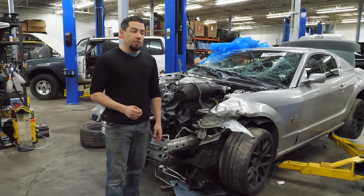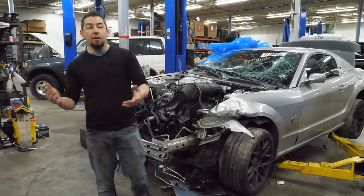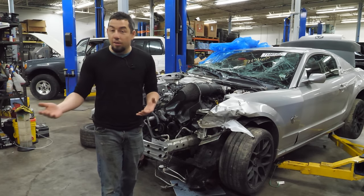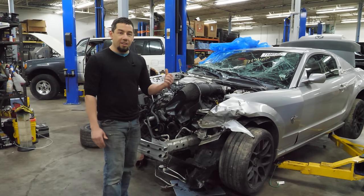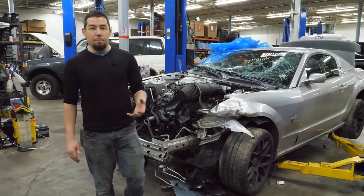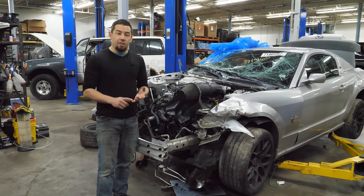Either way, this thing was rough. The head gaskets didn't look great, two freeze plugs were migrating out of the block, and the rust made this one so much more difficult. Typically a big block Chevrolet is an easy engine to work on but the rust made this one brutal. I'm absolutely filthy - I've got rust juice all over me and in my hair. But I still feel like I won. The last 454 I tore down I got jammed up at the harmonic balancer - couldn't get the timing cover off, couldn't get the cam or crank out. I was determined not to let that happen again.